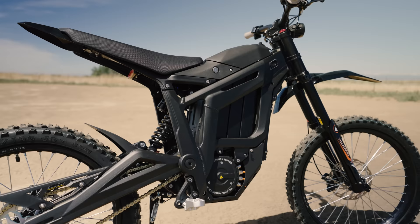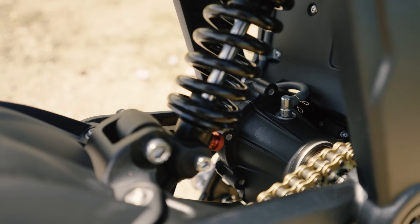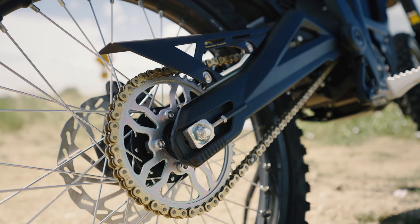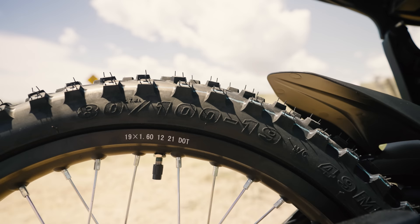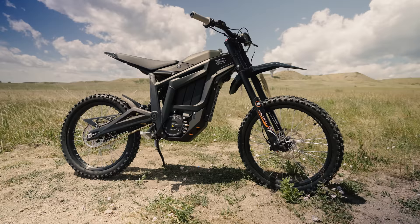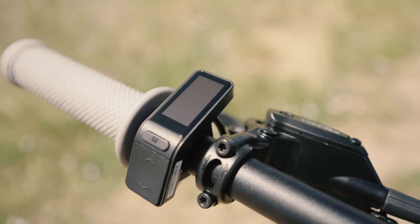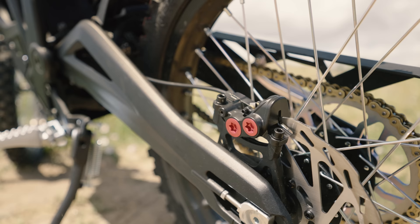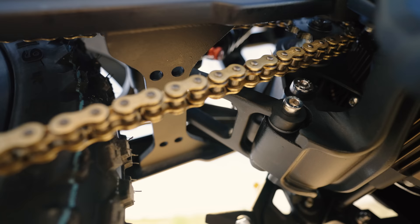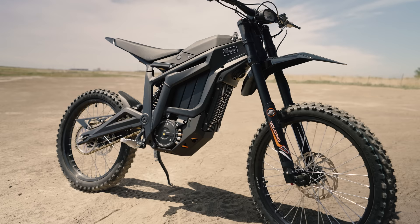The Talaria, on the other hand, is very new on the scene. This 2022 also produces six kilowatts of power and has a 60-volt, 38 amp-hour battery. The bike utilizes a gearbox instead of the belt drive found on the Suron. It came with a 44-tooth rear sprocket. The rear wheel is 19 by 1.6 inches with an 80/100-19 CST tire, and in the front a 19-inch wheel with a 70/100-19 CST tire. The Talaria is suspended by a DNM fork and a Fast Ace shock. Notable features include an Egg Rider display with easy-to-change regen modes, a slightly wider rear swing arm, and a different linkage design. The bike weighs approximately 128 pounds and the current MSRP from eBikezilla is $4,200.